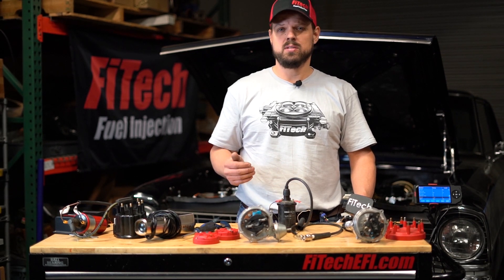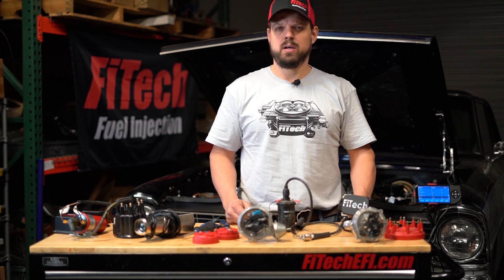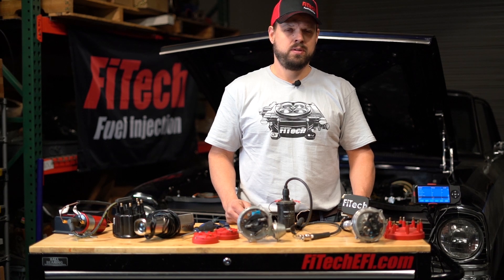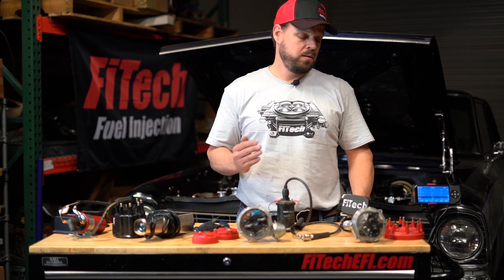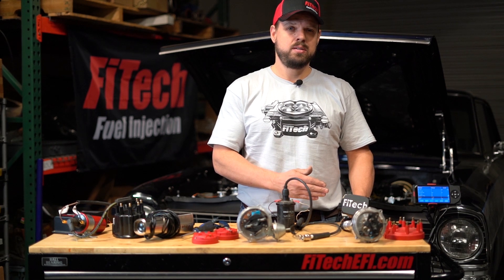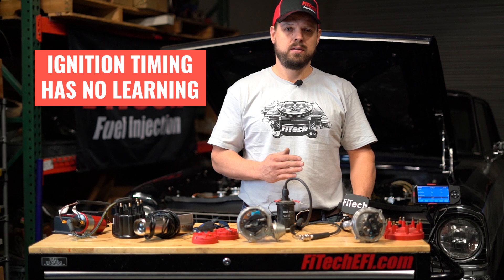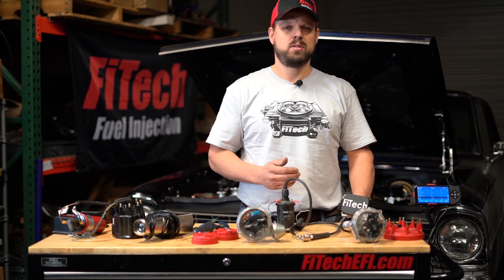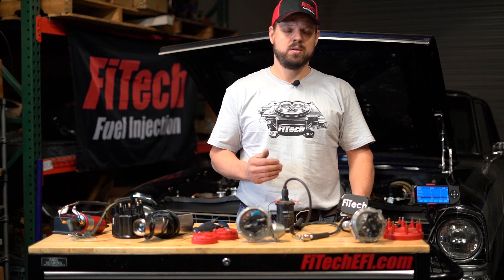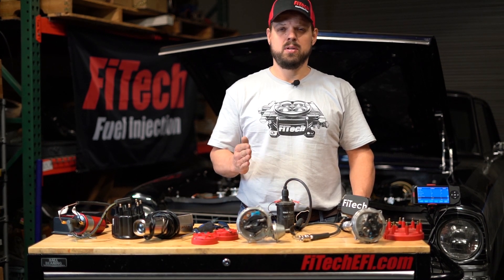You can experiment to see if your engine misfires if you advance further than 42 degrees. Our throttle body and Ultra Ram ECUs do not use knock control — knock control would detect knock and retard timing, but our system does not utilize that and does not learn anything based on knocking. So if you are experiencing knocking, you will need to reduce timing in the range where you're experiencing knock, typically at lower RPMs and medium to high loads.